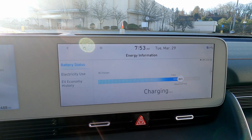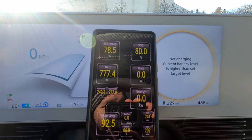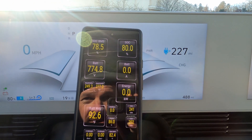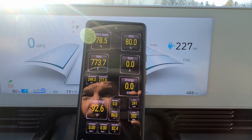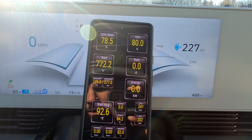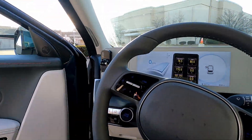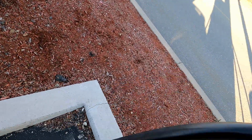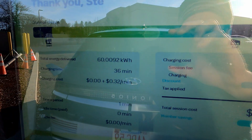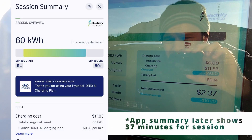This is set to shut off at 80%, and we'll see that happening there. Current battery level is higher because we've set the DC charger rate to shut off at 80%. That's finishing the session. Battery temperature is at 93 degrees Fahrenheit almost. Battery heater ramping down now from 86 degrees, and battery at 80% steady charge. So our final result: 9 to 80% in 36 minutes — a bit ahead of the estimate.